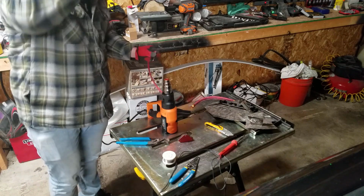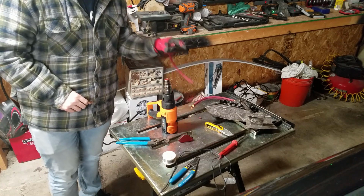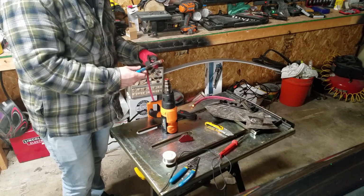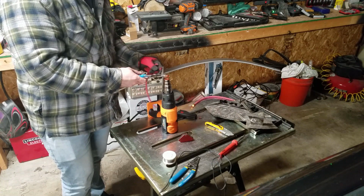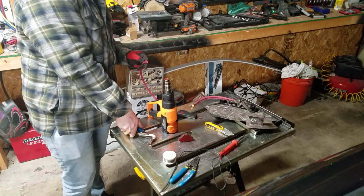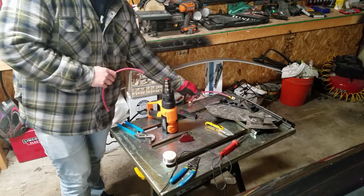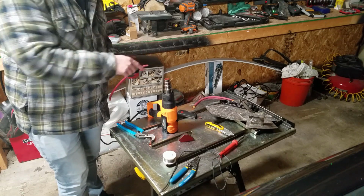Okay, so I've lost my good torch, and I got this little tiny butane one that honestly sucks. So this is my solution to solder these on. Basically holding the copper clip over the heat gun on its highest setting, basically like a torch, until it gets hot enough, and then feeding the solder in and then insulation in. So I'll do this other side of the positive. I already got my negative side done. I still need to put heat shrink on. I kind of forgot, to be honest. So I'll get those on, and then we'll put it all in the car.